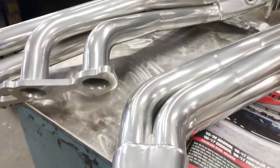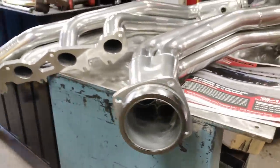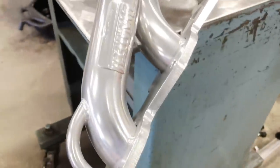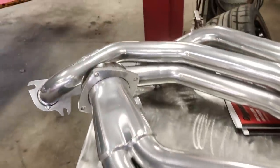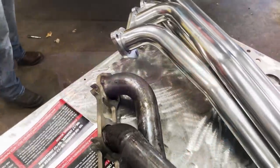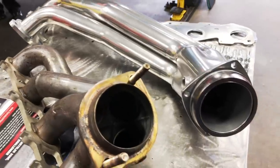The same could be said for long tube headers. If you go with long tube headers with either no cats or high-flow cats, your car will operate and you'll likely pick up horsepower, but you do run the risk of check engine lights. I don't have firsthand experience with that. When I had long tube headers, I gained around 10 wheel horsepower over the shorties without touching the tune.